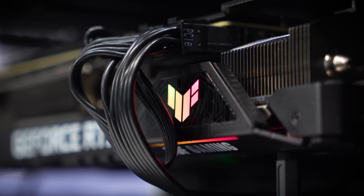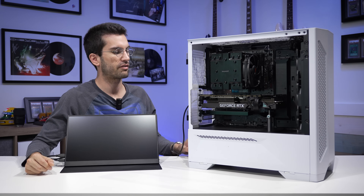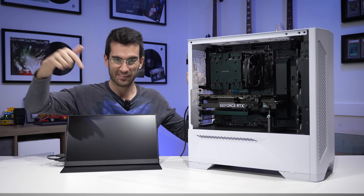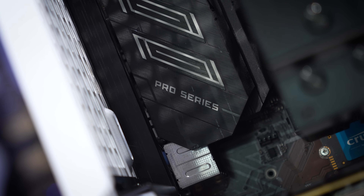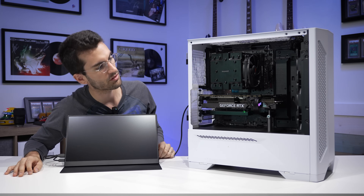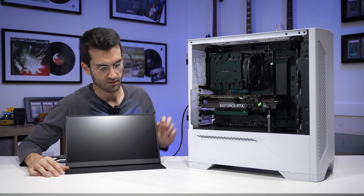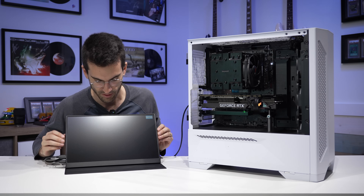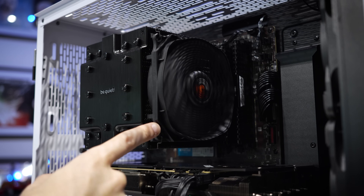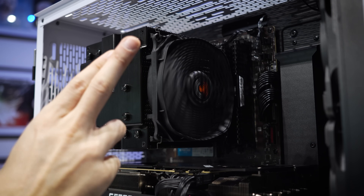If the viewer doesn't like the fan setup at the end of the day, he can always change it — it won't take very long. The last thing to do is attempt to power it on. I did verify that this build worked ahead of time — I don't like turning these on when they're dirty in the office, so I tested this outside in a rudimentary way, which is why it wasn't on camera. Let's make sure it still posts. It has fired up again — we're not going to have RGB for the case lit up because we're missing that power cable. There we go — we have a post. I also noticed the CPU cooler fans, both of them actually, were not spinning. I've swapped headers; I think the other header was disabled in the BIOS, and that has fixed the problem.